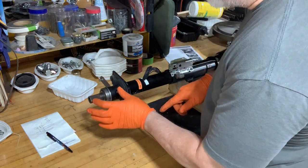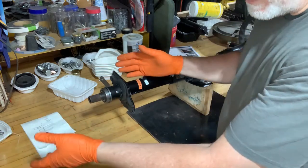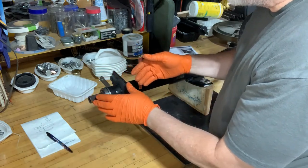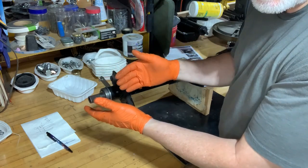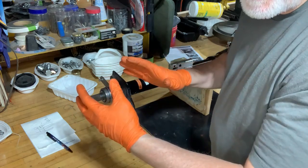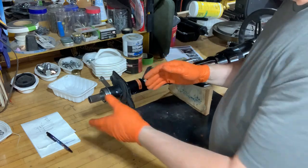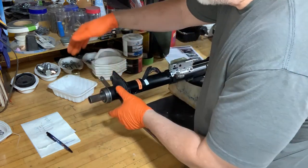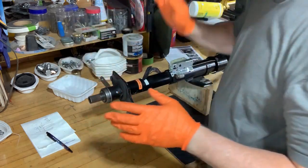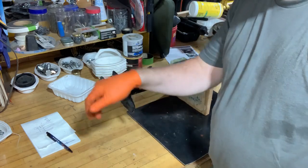But here's my theory. Maybe when this gets shoved in, that causes something to bind up. So if I pulled it all the way back out to where it was, maybe it wouldn't be bound up. Well, that won't work, but what if I shove it in, say another 1/8 inch, 3/16 or something like that, and then pull it back out to this 1 7/8? Maybe that would cause whatever's binding up to stay back here and then the shaft can come out again and then it would be looser. I probably need to have a way to measure how hard that pulls. Not quite sure how I would do that, but anyway, that's my latest theory. That's what I'm planning on doing here today. Cram that thing in further and pull it back out.